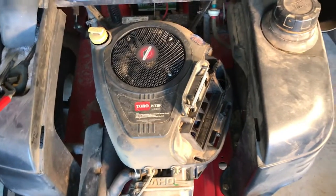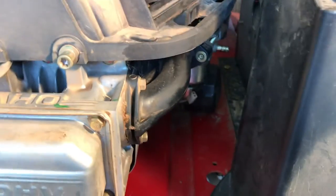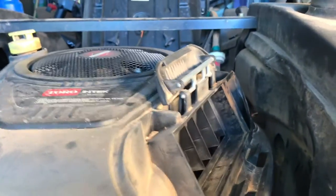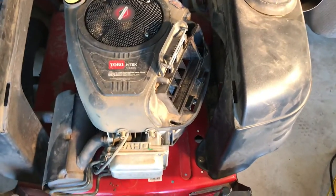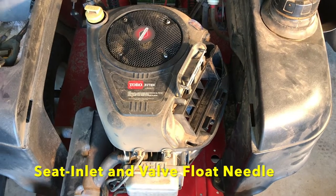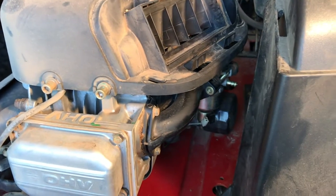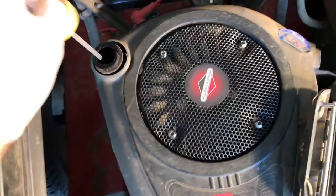Well hello there, it's March 27, 2019. Today we're going to be replacing a seat valve and a pin in the carburetor. About two months ago I came out to the garage and smelled gasoline — the carburetor had filled with gasoline and was leaking all over the floor. It's since been cleaned up, but research says I need to replace that seat valve and pin inside the carburetor.